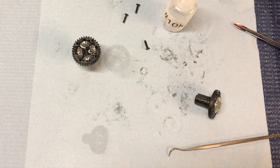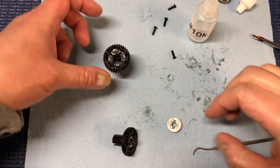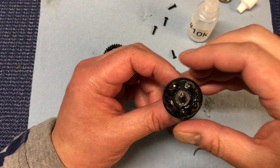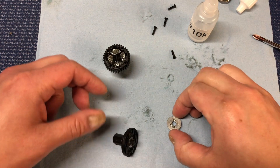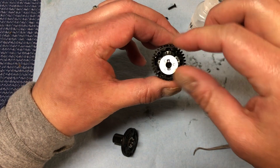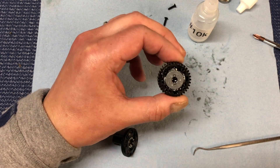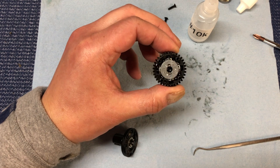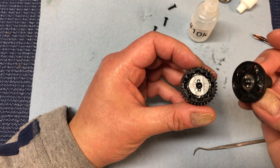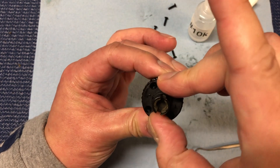We're going to let that settle for a little bit. Okay, we've let the fluid sit for about 10 minutes. The next part is to reassemble the diff half. The easy way to make sure all the gears mesh is to set up your top half so that the pin is going up and down vertically, with the four screw holes on the four corners. Then the sun gear — you're going to put it right back into the diff so that it is flat, and turn it so that it is also straight up and down with that little slot. I pretty much filled the fluid up to the top of the cross pins when it's all settled.